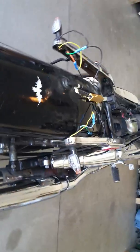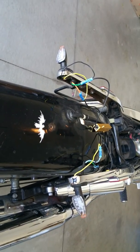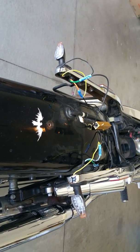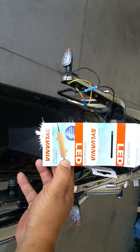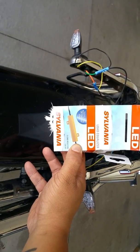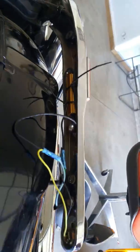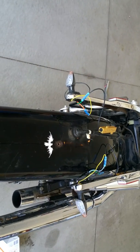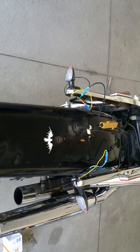I disconnected all of the factory stuff and got these new ones, but they didn't work. I was thinking my wiring was off or whatever else. These are $14.99 from AutoZone — Sylvania load equalizer LEDs with two resistors in each. They're kind of big in comparison to where I'm going to tuck them in, but if you're doing LEDs on your motorcycle and your rear end isn't working, like mine wasn't...